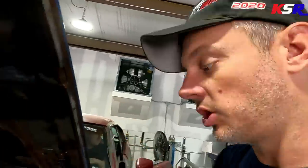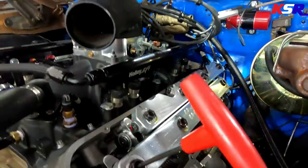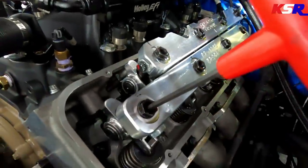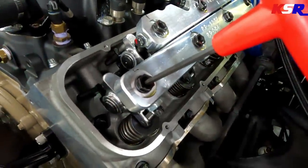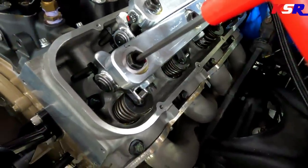Oh boy. All right, so this feeler gauge is 12 thousandths thick, and that is the spec for when the engine is cold. When the engine heats up, it's actually going to change that spec, but Blueprint gave us a spec to check while it's cold. So let's see if we can make this happen, and I'll do a couple of cylinders and then we'll time lapse until this job's done and we'll get back to making some power. All right, bump it.